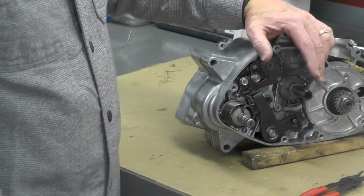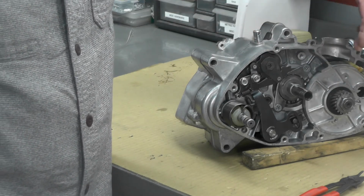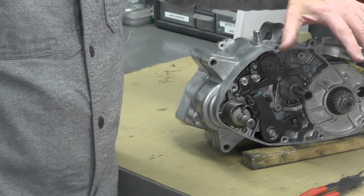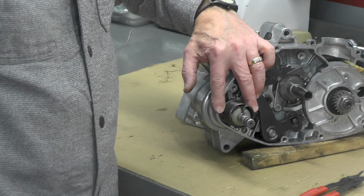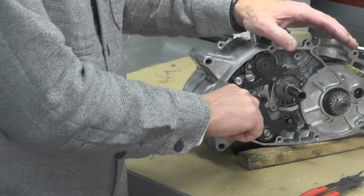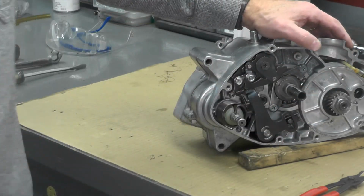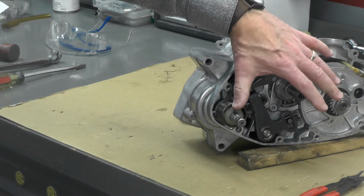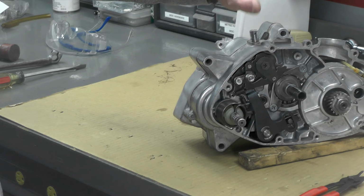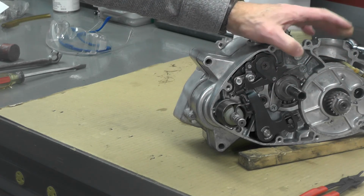So I think at this point we're going to call this video a wrap. We've got the rotary valve, the cover, and the drive pinion installed, torqued, and all in place. We've got the return spring from the Kickstarter installed back the way it was originally. So I think we've got those two major elements done. Next video will be installing the clutch basket, including the clutch plates, clutch springs, getting everything put back together in terms of the clutch. I think that will be one video in and of itself.